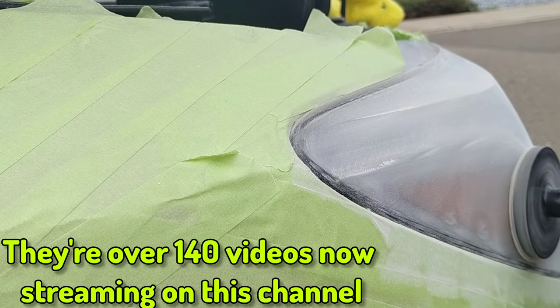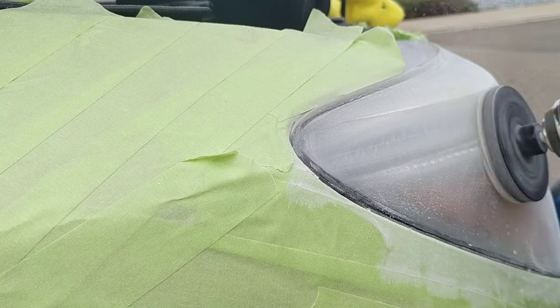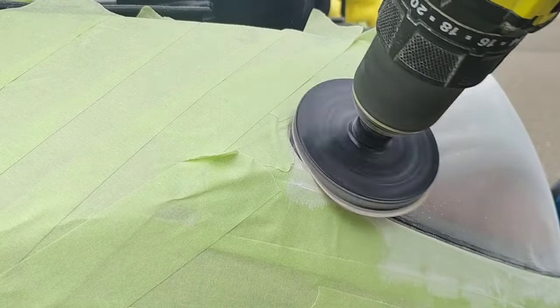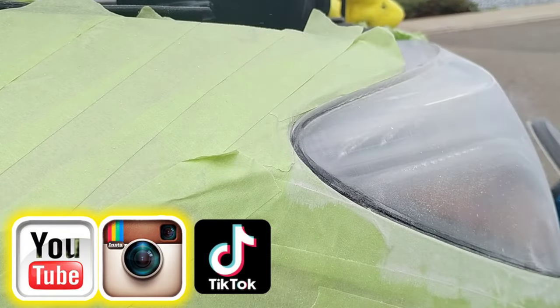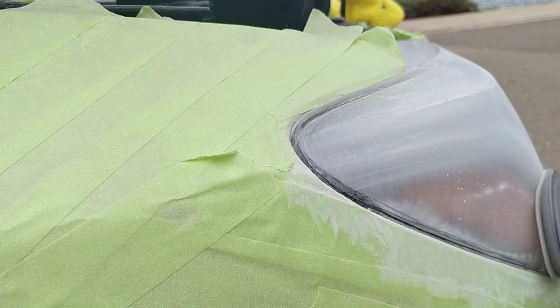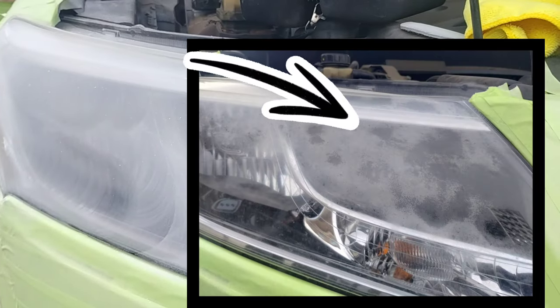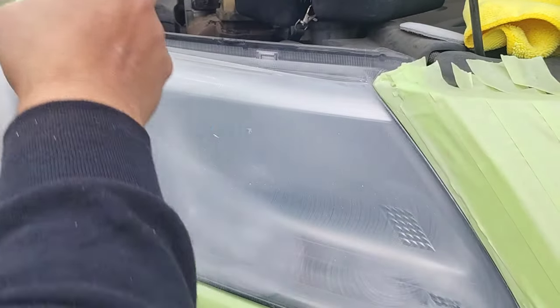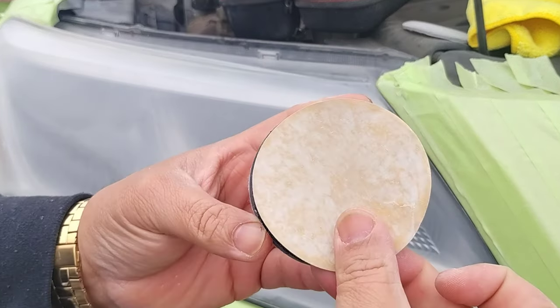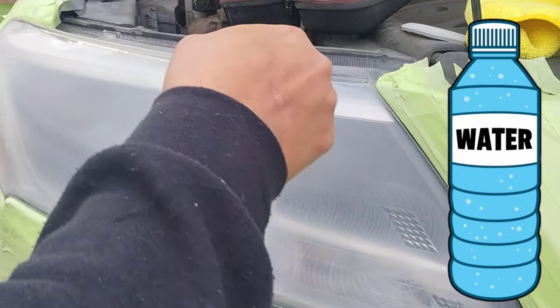This headlight is somewhat difficult — not because of crazy shapes, though it has a little bit of tricky shape up top. It's just really big and set a little weird, and you're going to have to use a lot of material if the light isn't bare or naked. Most of the clear coat had died except for those really white areas that were down to the actual polycarbonate. So I only had to use two P500s. When I guesstimate, things aren't always correct — all discs aren't created equally, and you'll be seeing more about that shortly.